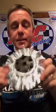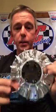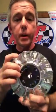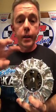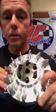But the 6617, like I say, it looks like an 18, but they're size specific. Adjustable hub. Adjust the timing basically on the fly. At the racetrack, on the dyno, most of my engines, whether it's a PVL ignition or a standard ignition, go to my dyno with an adjustable flywheel on it so I can adjust the timing on the dyno, get it set where I want it, and then put the standard flywheel on it at the timing that this flywheel tells me. But this flywheel can be used on a couple of different engines.